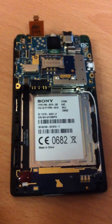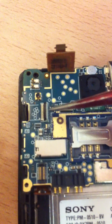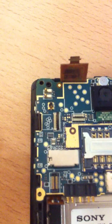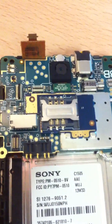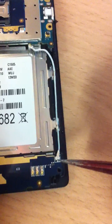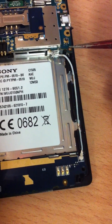Once you've taken everything out, this is what you've got left. There will be a black sticker covering these two connectors here — these are the connectors for your LCD and digitiser. This one at the top with the IC on it is for the digitiser, and this little one here is for the LCD. There are no screws that hold the main board into the chassis of the handset. The only thing that connects it is this antenna cable here, which connects to the bottom side of the board just about where I'm indicating.